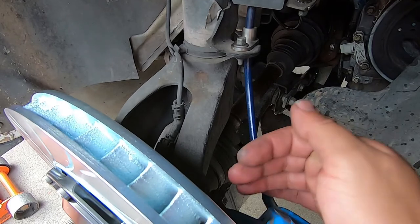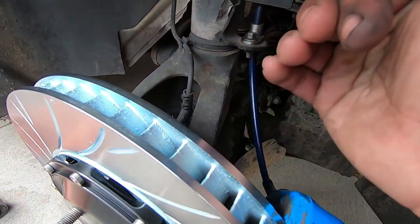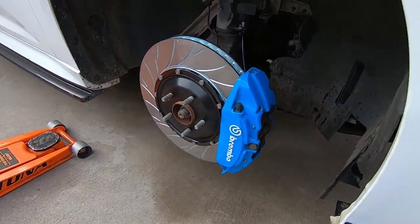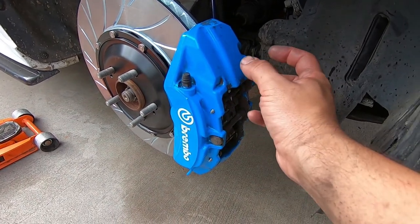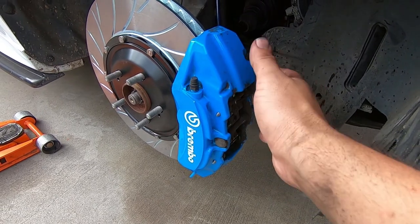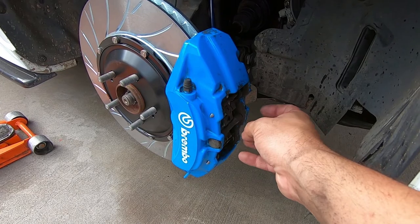We went ahead and removed the heat shield in the back, so the deflector is gonna truly hit the vast majority of the brake rotor now. So cooling performance is gonna be right up there. And the H2 pads are designed for street, but you can also order their track pads as well, or a more aggressive H6 pad if you do very hard driving all the time.